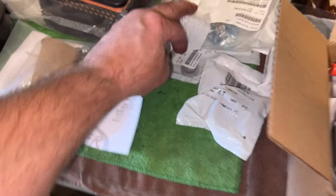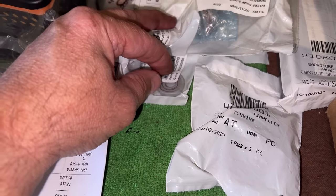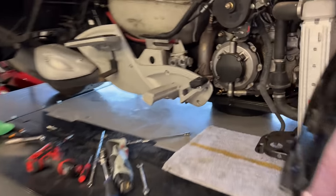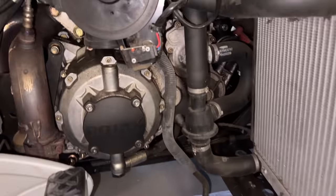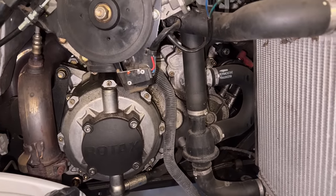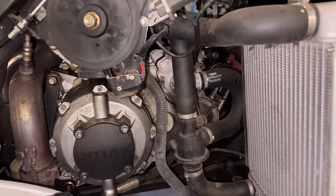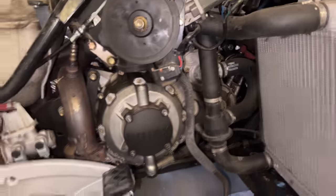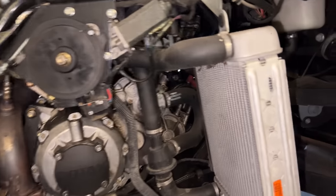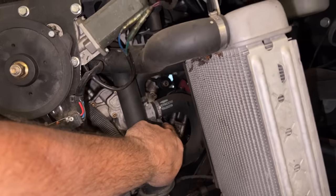The new updated water pump — if you're not putting that gray oil seal in here, stop. Because it's gonna leak again. I think the original one was a black one, then they came out with a red one, I think there might have been a green one at one point. Once they went to that gray oil seal, all this crazy leaking stopped. Right up in the front here is where the weep hole is.